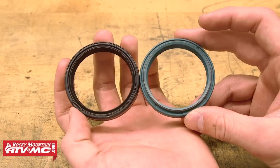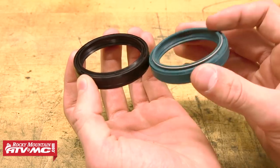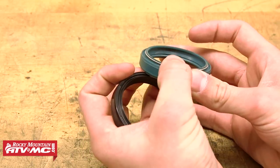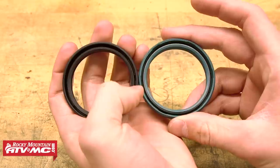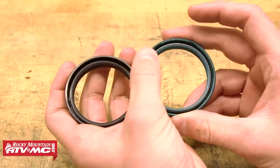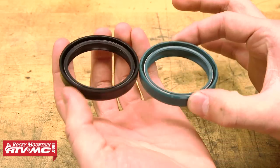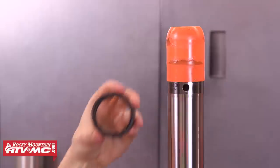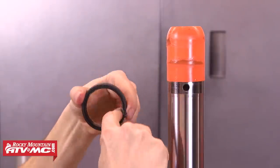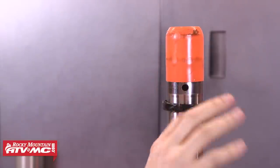Here's a quick tip on knowing which way your oil seal needs to be installed. All fork seals will have a lip on the bottom that usually sticks out away from the seal — some will have a pressure spring on that lip and others won't. When you flip them over to the other side you'll see a groove in the back of the seal with another lip and a pressure spring down inside. This is the side that always faces the oil, because the oil and pressure inside the fork gets in around that lip and creates the seal. So on these forks the oil seal would always sit with the groove up towards the oil. Now we're going to grease the new oil seal using plenty of grease and carefully slide it down onto the fork. We also like to put a little grease on the outside of the seal to make it easier to remove in the future.